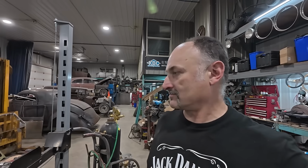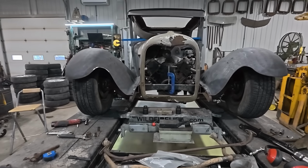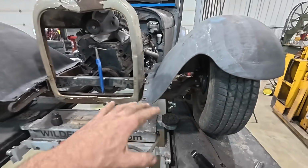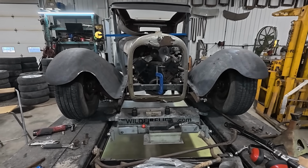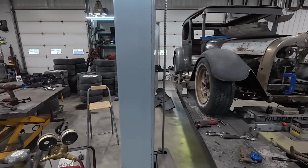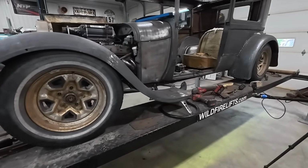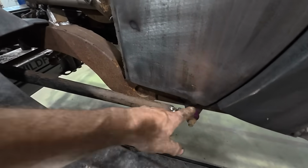All right. There's been a compound of things that have been happening here, and a lot started to go wrong. So, what did I do? I ended up just throwing in that other spring, even though it's wrong. I had these shackles, I reversed them, and it sits way too low, but I know I want to do a reversed eye, to get the front down a little bit. Then I changed the arms because I wanted the shorter arms so I have somewhere to mount my fender. So I started messing with that. Then I realized I got this here, but it's not going to work.